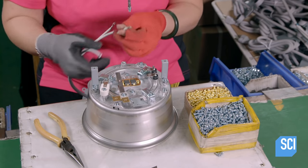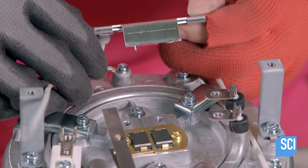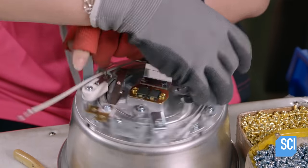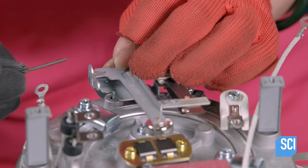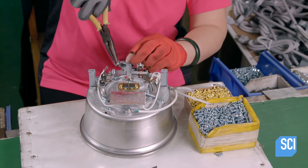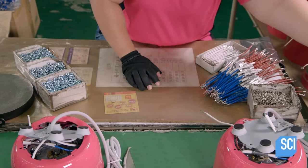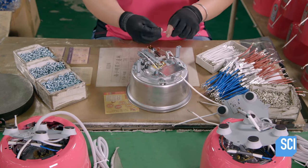The technician connects the power cord and attaches the thermal insulation sheet, which allows the cooked rice to maintain a temperature of 158 degrees Fahrenheit. This part of the switch mechanism hovers over the magnetic core. When the cooking temperature hits 158 degrees Fahrenheit, the core activates the switch to turn off the heating element and start up the thermal insulation sheet.